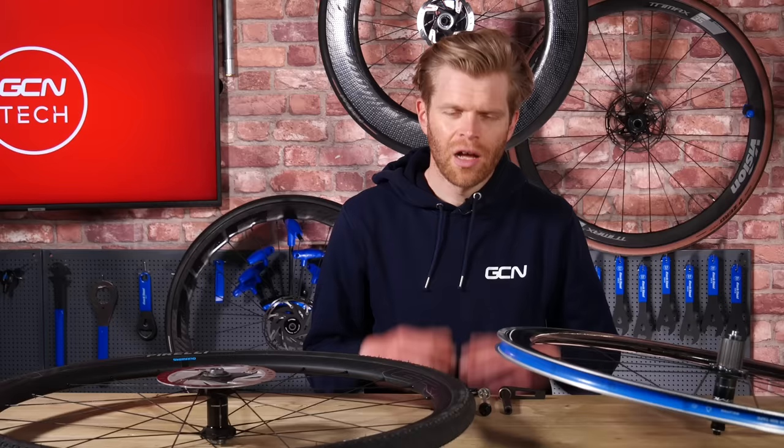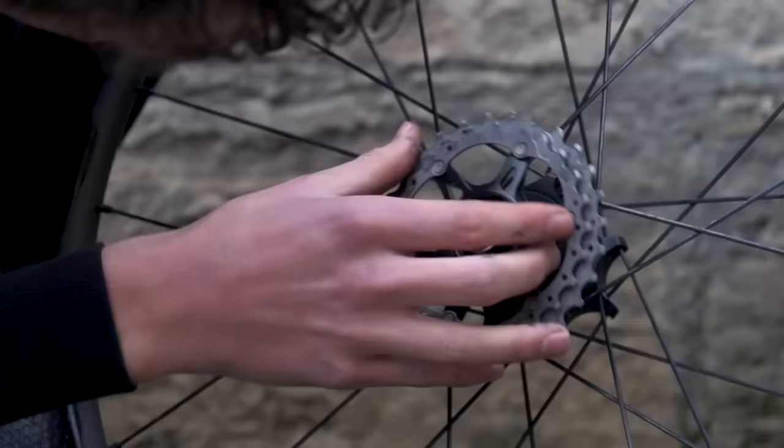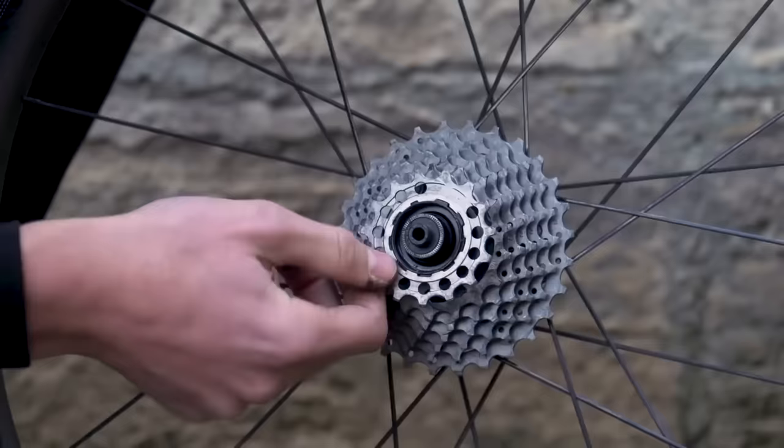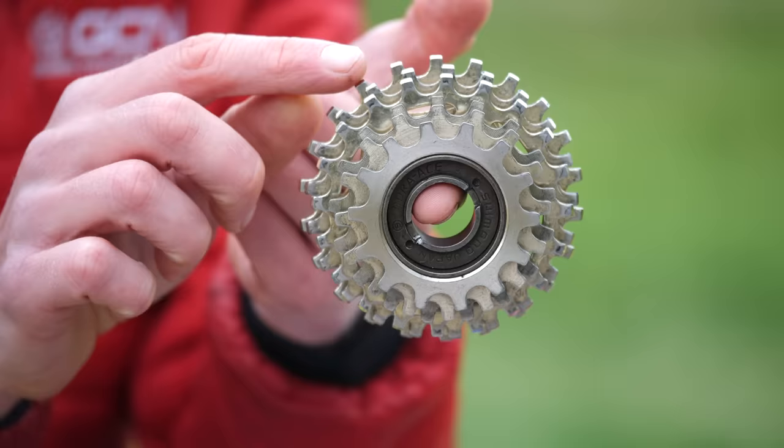Track wheels and road wheels are different too. Wheels designed for the road have a free hub on the rear wheel, and this is where you can attach your sprockets or your cassette, whereas track or single speed wheels don't have a free hub or space for the cassette, as they're just designed to accommodate a single sprocket. The other thing to note is that there are different types of free hubs. SRAM and Shimano free hub bodies are compatible with each other, whereas Campagnolo use a different type. If you're using a 12-speed cassette, they can use a different type of free hub too. Older systems such as the pre-Shimano Hyperglide cassettes have a different spline pattern, requiring a different free hub as well. Just be aware of it and make sure you get the right free hub body for the cassette you intend to use.